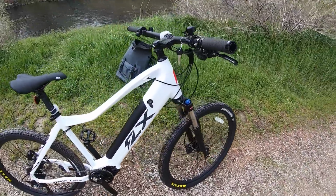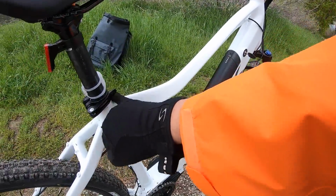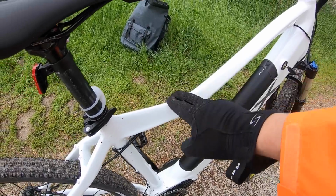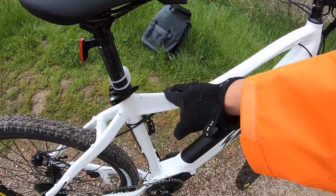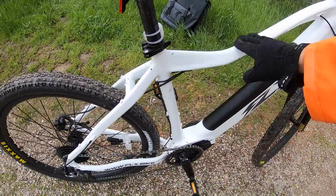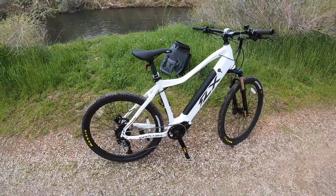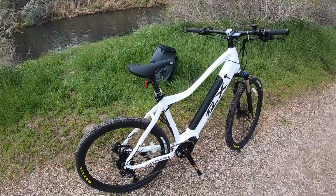So this frame is not entirely approachable. They do have kind of like this top tube that slopes down a little bit. So the minimum standover height is 29 inches. So it's 29 inches from the ground up to this point right here. So you do have like a little bit of a step in there, but all in all, it's not entirely approachable, and that's fine because this bike is meant to keep its rigidity for, well, for mountain biking.